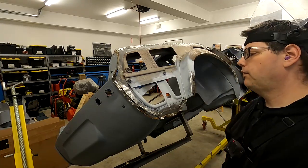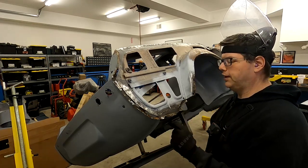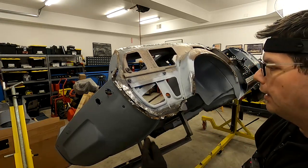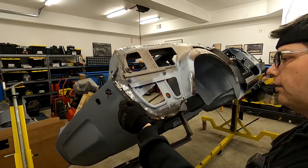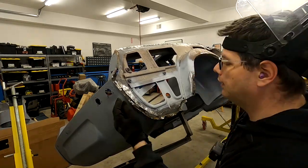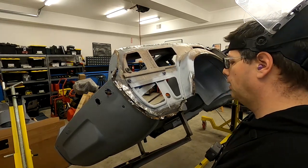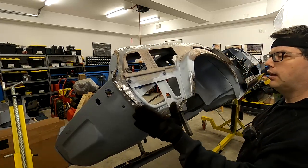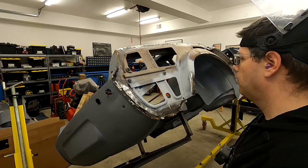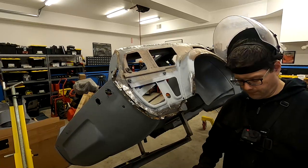All right, so basically, we're going to come through and clean up this flange. I did cut two spots in it, so I'll put a little bit of bridge metal in. We'll get this flange nice and repaired. I'm also going to pull out this area here on our valance. I do believe this was a minor accident now that I see it. It looks like there's just a tiny bend there. So we'll pull that out, get it matching the radius. Then we'll check our metal size, and start welding once the flange is done. I'll do a lot of this cleanup off camera because it's boring, and I'm going to save some battery and cards.